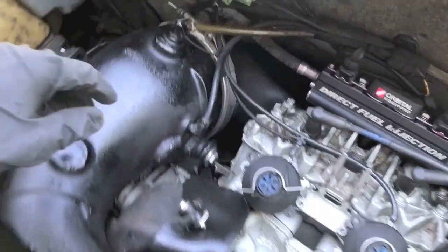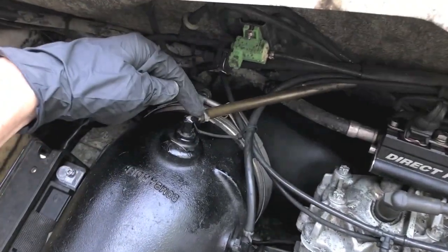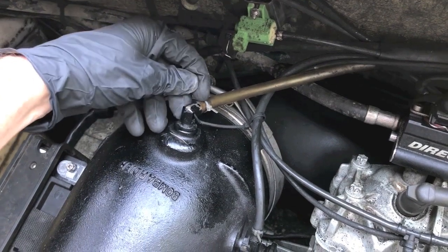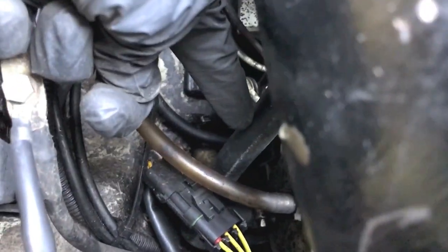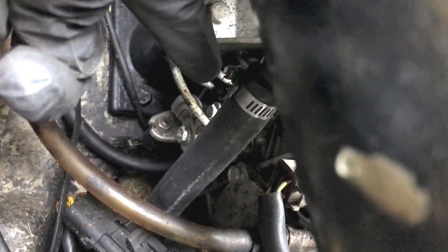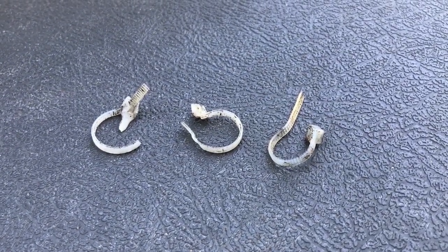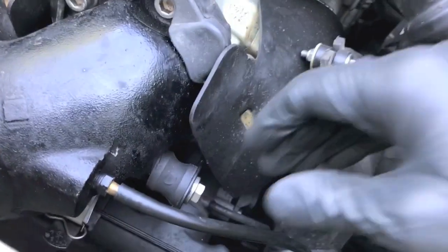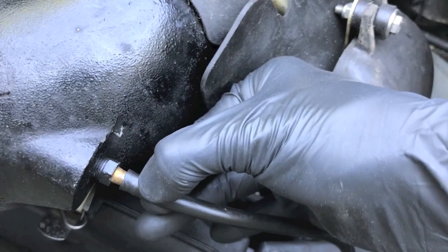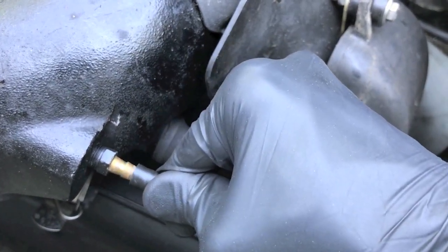The first few things I want to remove are the hoses that connect to the actual portions of the exhaust manifold. I'm going to remove this hose — you can see it's tie-strapped on. I'll go ahead and clip that tie strap, one here and one right there. On the bottom side there is a hose that feeds into a clamp. Grab your flathead screwdriver and go ahead and remove this hose. The plastic tie straps are removed — I'll use new tie straps when it comes time to reinsert and secure the hoses. Let's carefully remove each of these hoses, grabbing at the actual portion where it connects, slowly shifting it rearward and pulling it off.